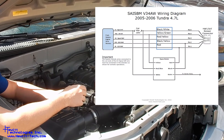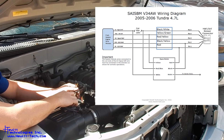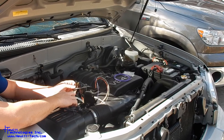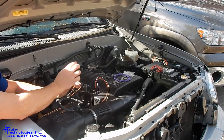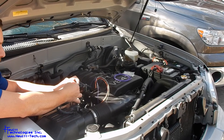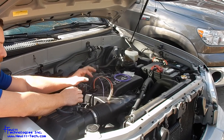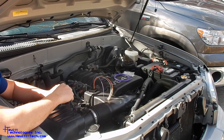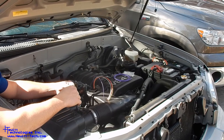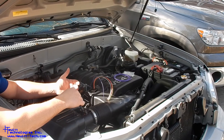In the installation instructions, there's a wiring diagram that these wires will match for your vehicle. The diagram also shows you all the connections that you will need to make. There are three wires that we'll need to just tap into, and then there is one wire that we'll need to actually cut. That cut wire — each side will make connection to one of the bypass module wires. In the installation instructions, we recommend soldering as the best method for making these connections, since it's the best way to ensure that you don't have any extra resistance and the connections are more secure.